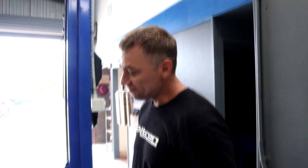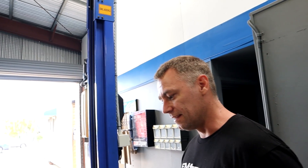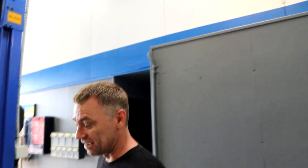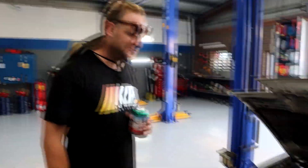Just your typical SR things — the things you do to an SR to make them strong, hopefully hold together. There are so many schools of thought. Like in the Holden's car when I used to race it, we went from stroked to back to two litre and actually made more power — using the smaller stroke to have more revs. It's an early S13 head with two mil oversize stainless valves, heavily ported 272 solid cams, 12.5mm lift. It hangs in there — spins it to nine grand but if it hits the rev limiter it breaks rockers, so he tries to stay away from nine grand. Running 28 psi and made 596 horsepower.